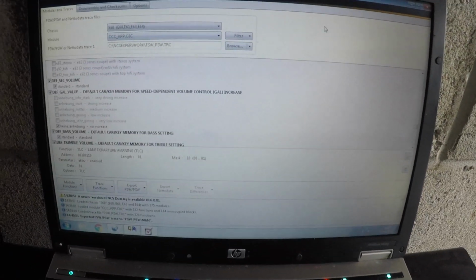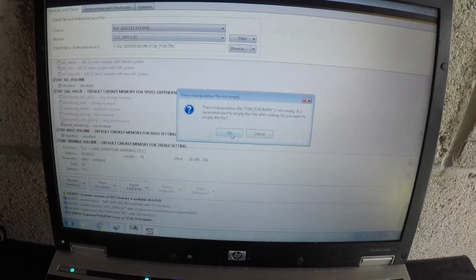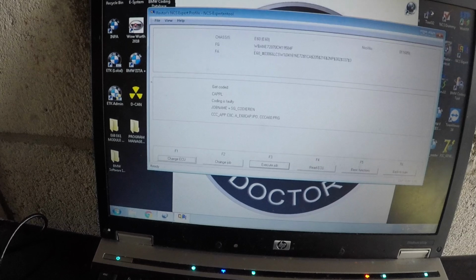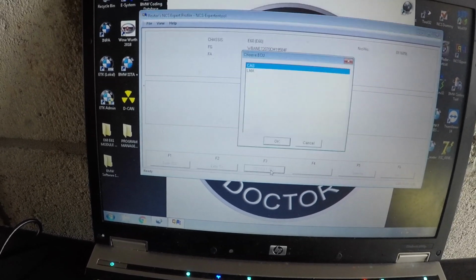So guys, now that's been coded in, what we want to do is click empty the trace file of NCS Dummy. Now we're going to go back to the main, and we're going to go to VIN. Then I'm just going to change over to the CAS again.